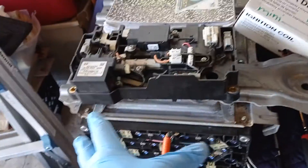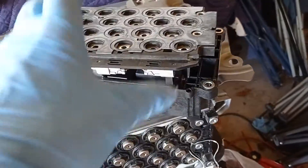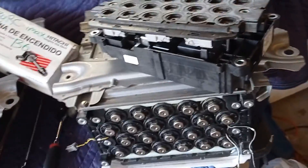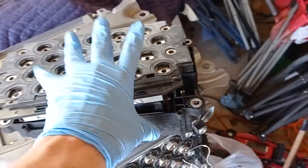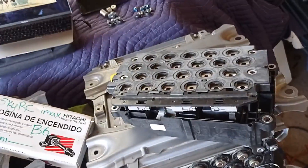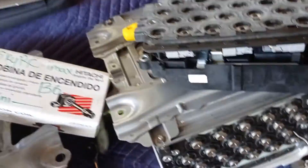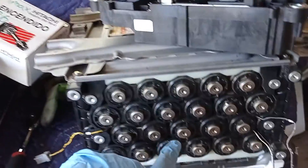This battery has no error codes but it's a weak battery. The other one has codes — hybrid battery deterioration and maybe one or two more — and it just doesn't communicate with the junction board. There's no charge, no assist. The junction board seems to only be capable of charging the 12-volt battery. Functionally I can drive the car, but there's almost no charge and no assist, and it doesn't recognize charge or assist anyway.